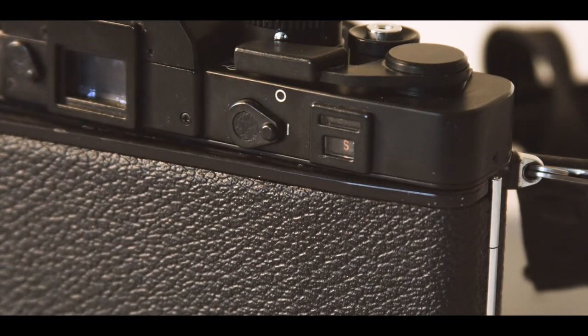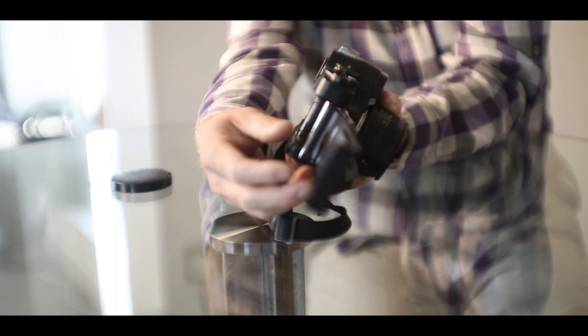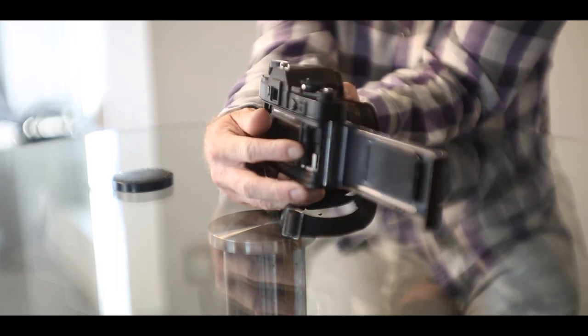You can turn it on and off here and there's a nice little frame counter. There are a couple of things that are cause for concern though. Opening it up, on the take-up spool there's a piece of plastic which you slide the film tab into — that's just another place for something to go wrong as the camera ages, since the plastic can become brittle and break. The other concern is this window in the back: windows in the back of cameras are never a good idea on 35mm when you don't have a paper backing to the film, as anything wrong here will cause light leaks onto your film.